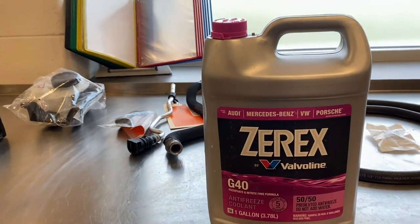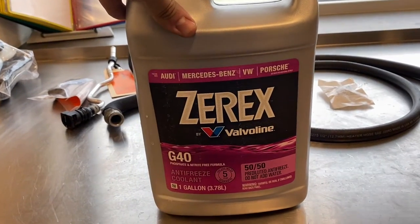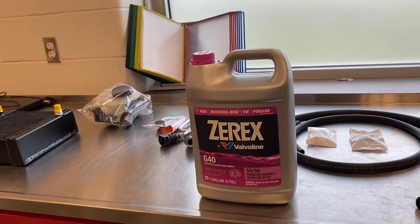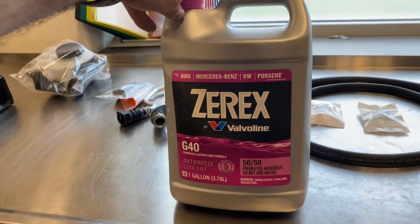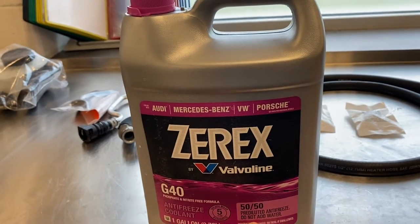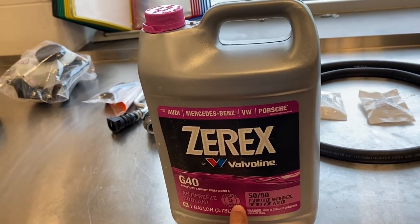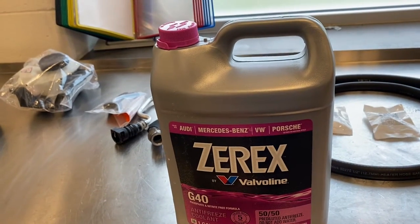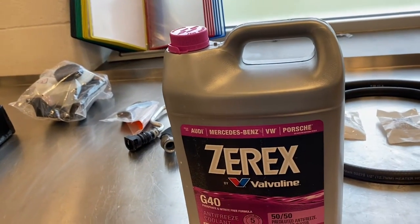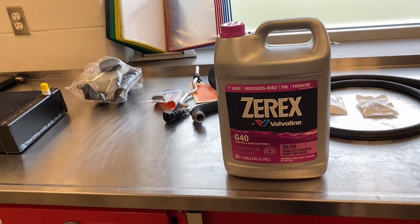We will be using this particular formula of coolant for both systems. We are going to have to drain the radiator during this process. This is going to be equivalent to OEM — many people are very sticklers about running Mercedes-specific fluid. This is what I would recommend if you can't run into a dealership locally to get the actual OEM stuff. It's made for Audi, Mercedes, Volkswagen, and Porsche, and it's 50/50 diluted already. For the engine I'm running normal 50/50, and for the exchanger system I'm running a 70/30 mix — 70% water, 30% coolant — to get the most out of the heat exchanger and split cooling setup, while still protecting against freezing in Texas.